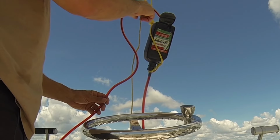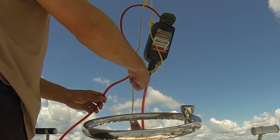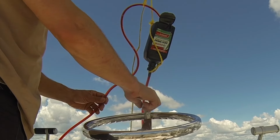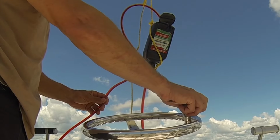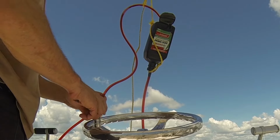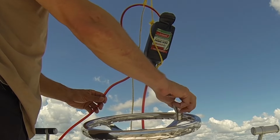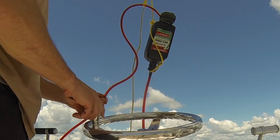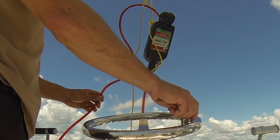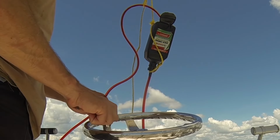All the meanwhile, you're making sure that there's still plenty of fluid inside this container. You don't want it to suck down air. I'm going to turn the other way now. Give it about 10 turns or so. There's some more bubbles there. And we'll go the other way. And you're going to keep doing this until you no longer see any more air.